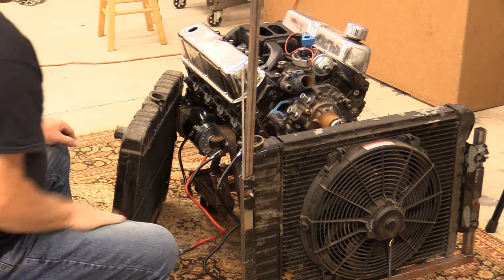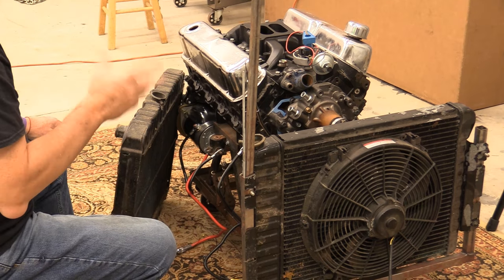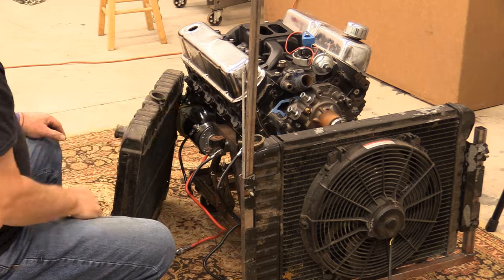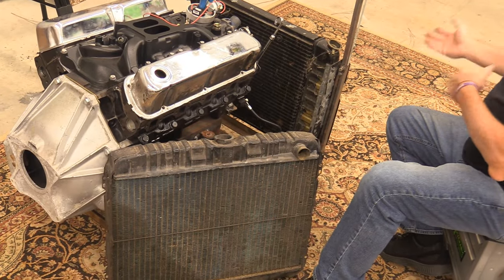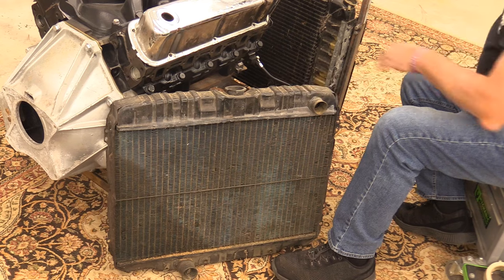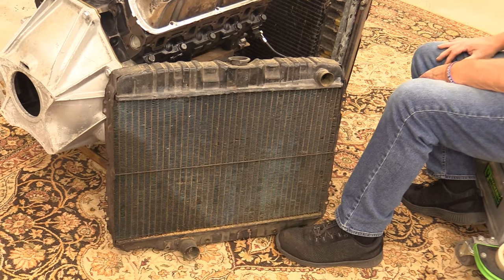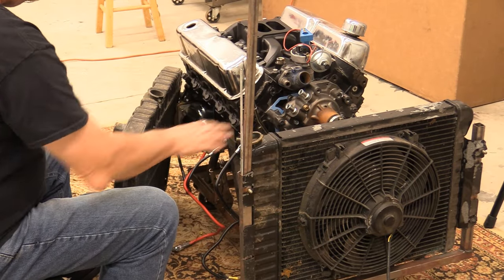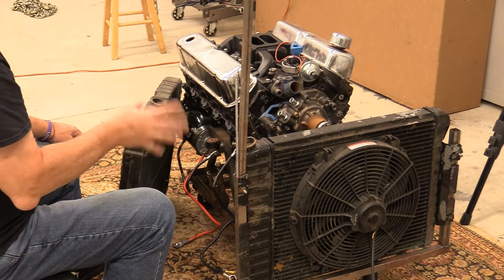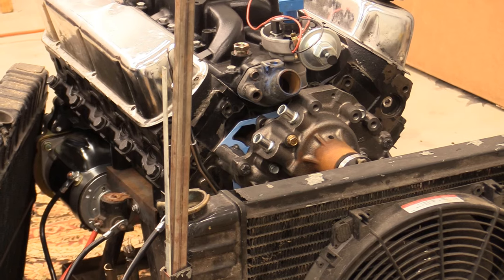The radiator we have on here is for a 1968 or 69 Camaro — it's an original radiator for those cars — and quite frankly the hose setups we have are not going to work. I happen to have an old Ford radiator in the shop, one for a big block 428 Cobra Jet, but it will work for small block applications as well. We'll get some stock hoses, probably from National Parts Depot. The pulley system will have a short belt so we can just run the water pump.